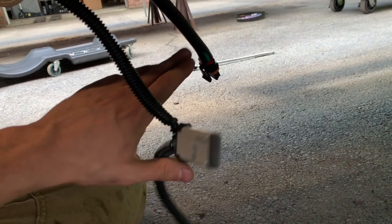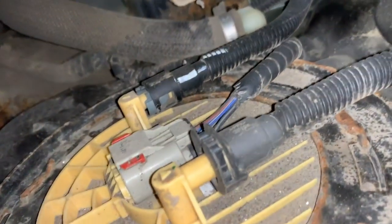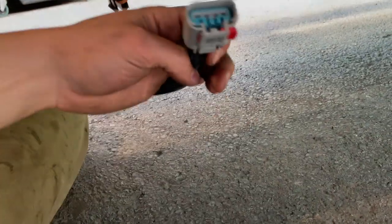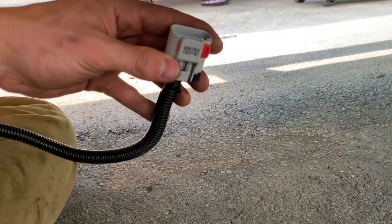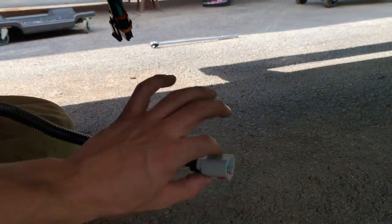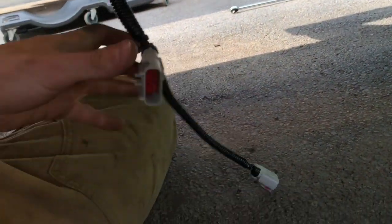As far as a trigger wire, you don't have to worry about finding a fuse like you do on GM trucks. What you do is go on top of the tank to the sending unit — you can see right in the middle of that gray connector, that's the factory one. We're going to take off that harness, which is essentially a replica of the FASS harness. It does two things: it has a sending unit to tell your fuel gauge what level it's at, and it also tells the lift pump when to turn on and off. That's where you splice in to get the cue from the factory wire — you can't completely eliminate it because you still need the float to tell the fuel level.